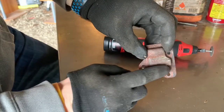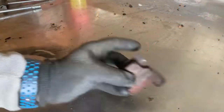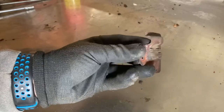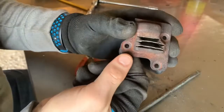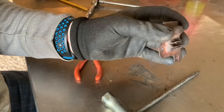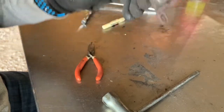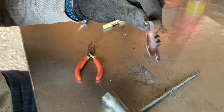I'm going to go ahead and finish grinding those out and then I'll end up bending the fins. What you should be left with is three nice little slits. I went ahead and did the edges to help me bend it whenever I put the flathead into it. Now that I've got the fins placed the way that I want, I went ahead and bent them and straightened them up a little bit on the inside. You should see a nice straight flow, and from the side the fins are pointing up so the exhaust is going away from you.